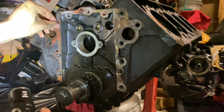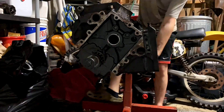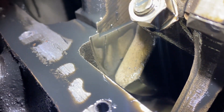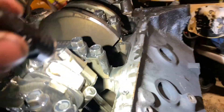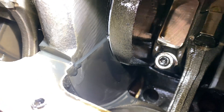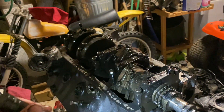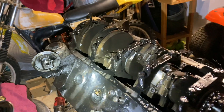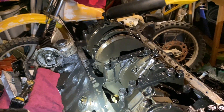So I think we're about ready to start pulling pistons and the crank — keep our fingers crossed on that one. I figured I'd go ahead and show kind of why this block is junk. See right there? There's a good crack on that one. See that crack there? That one's cracked and it's the same story on the other side. There's that one. There's that one. I don't know if this one's cracked, but yeah, the cylinders are junk — which could be fixed. But those cracks, especially on this side here, it's so bad. This block is junk. I'm kind of lucky that it didn't break in the truck while I was driving.